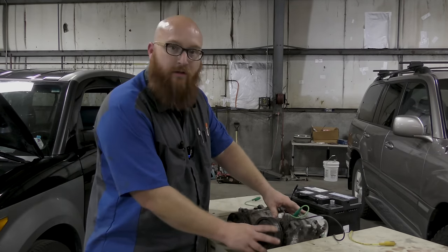I have actually experienced a customer who put on his own compressor, and he said, I've been through three of these things. They're making bad compressors. They're sending me junk. It is possible you get a bad compressor, but not three times in a row. I finally got his vehicle in and pulled one of the lines off, and it was like spray paint, like glitter. It was just metal all in the lines. Three compressors he burned up because he didn't clean out his system.